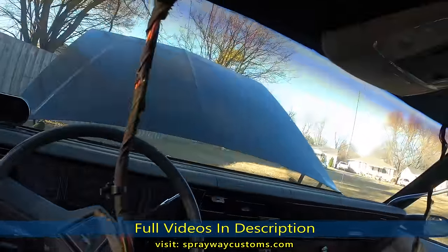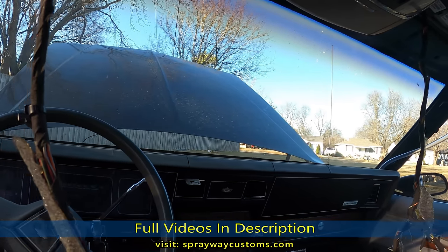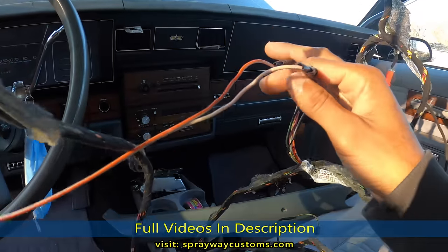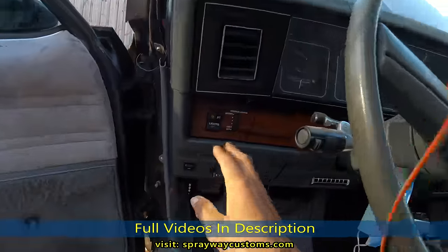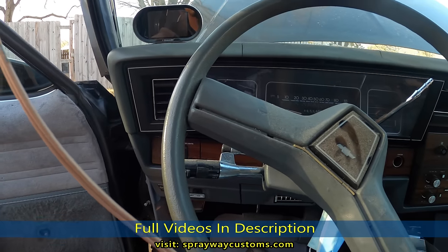But I don't know how they got this hooked up though. It's hooked up to the interior dome light. You can see, that's not gonna work though. Only way you can operate your top is with the door open or the dome lights cut on. Let me show you. Let me shut this door. Probably won't even work.